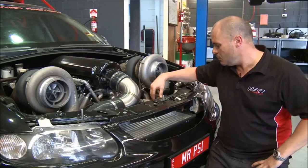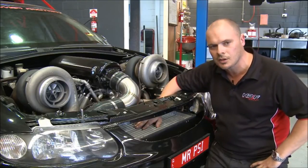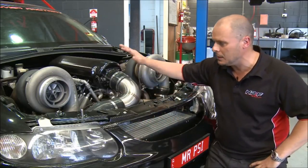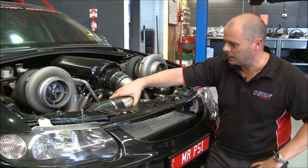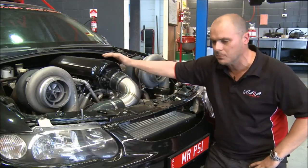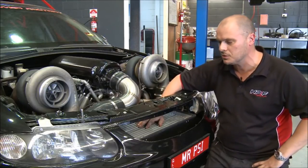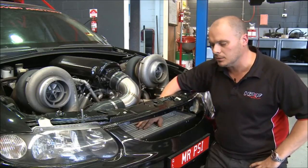And the air running through obviously is cooled by the dry ice cooling the core. Air is then exiting on the other side of the intercooler up into the intake manifold. And when you see this thing in full flight, you'll actually see the ice starting to freeze up the intercooler pipe and even the throttle body and the front half of the manifold, just because of how cool the temperature is that's being generated in the intercooler. So this is the ultimate.